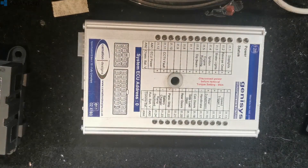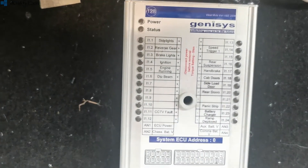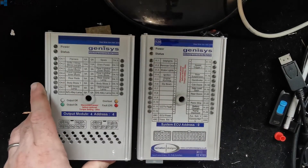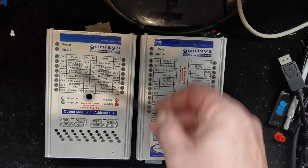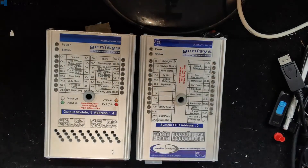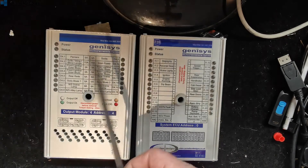So that's it really — just a couple of questions I've been asked. Can you remove them? Yes you can. Can you remove them absolutely? I've seen it done on vehicles that are still in service, and you've got most of the information you need here to remove it. My suggestion would be to kill the power to these modules, disconnect, pull the fuse out, and check that everything you want to work chassis-wise still works. Once you know there are no surprises in there, you can set about removing all the lighting and that — but be aware there are some weird things that go through these.